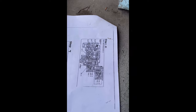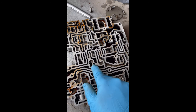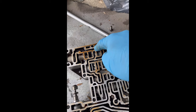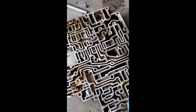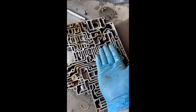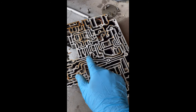The instructions show you where all the check balls go. You're going to go with one, two, three, four — number five is going to be hidden in here, and six is right here in a little slider so it bounces back and forth. Seven and eight — this is going to be your drain back valve. We'll be tearing these apart to replace springs as well. Also, when you remove the separator plate, there's a gasket on each side, and it's going to be caked on there pretty well. Be very careful not to scratch the separator plate because you'll be drilling it, and any scratches might cause leaks from passage to passage.